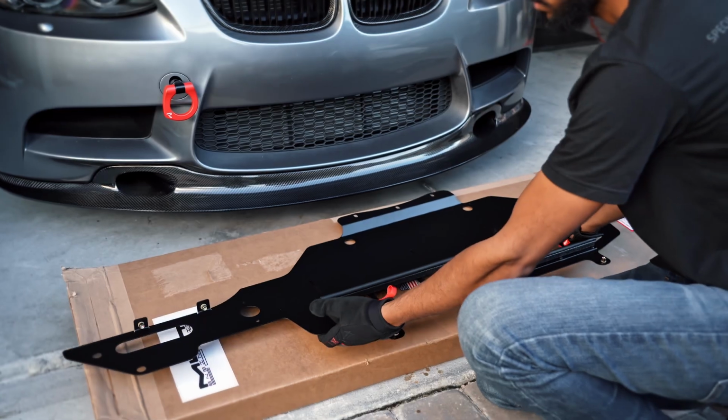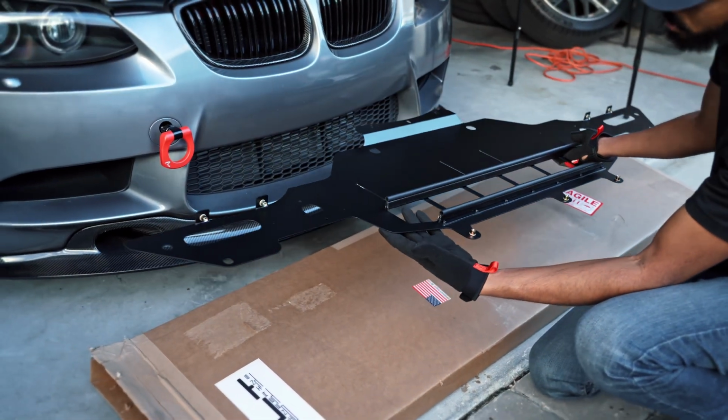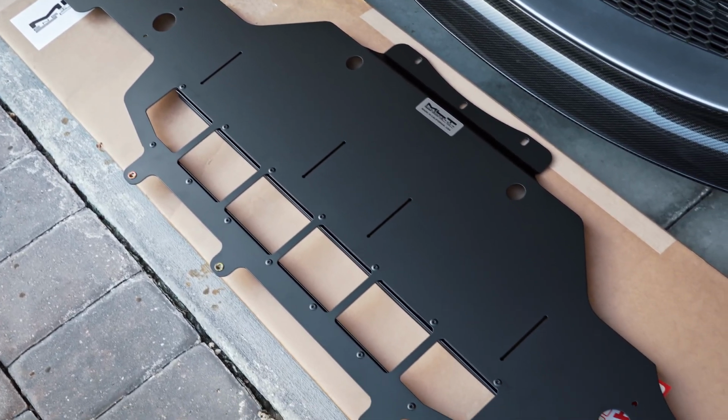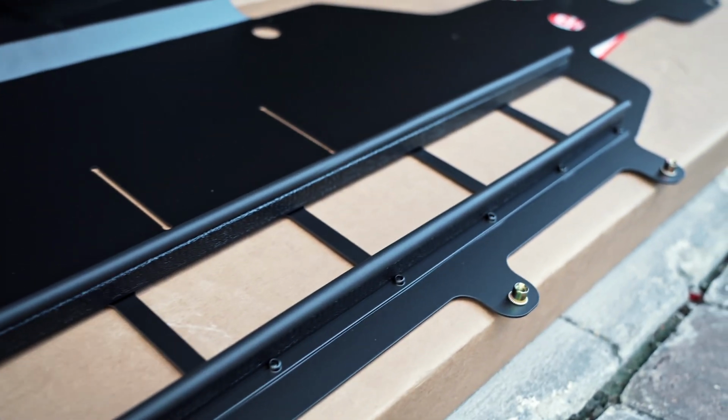Now, there are a few brands of aftermarket undertrays on the market currently, but I really think the one from MLT has the best mix of design, protection, and price. It's made from aircraft grade aluminum, reinforced with rear bends and L brackets, and then powder coated black for a durable, long lasting finish. The undertray is also available in either gloss or matte black. It retains a similar size cutout for the oil cooler air duct, and it comes with the rubber duct seals pre-installed, which was perfect for me as my OEM ones were missing.